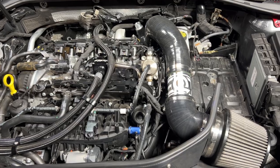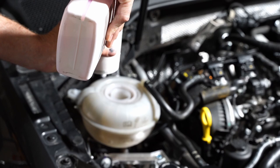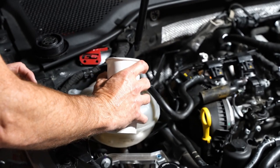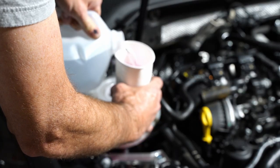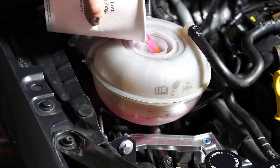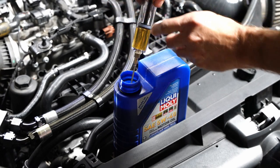The turbo is in and everything is hooked up. Before I start the car, I need to do a couple of things. First, I need to start refilling the coolant because I drained a lot. I'm using undiluted coolant and measuring with a Starbucks cup - equal parts coolant and distilled water, alternating until I get to a level where it's full. It'll suck down as I get air out of the system, and I'll keep topping it off the same way. Leave the top off the coolant bottle as you warm up the car - that'll allow air to escape and let it burp the system.